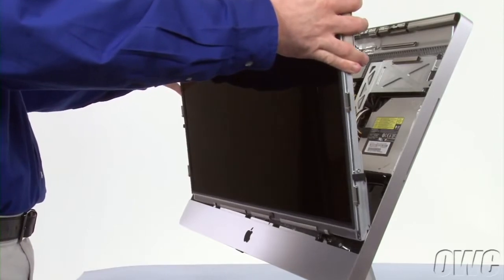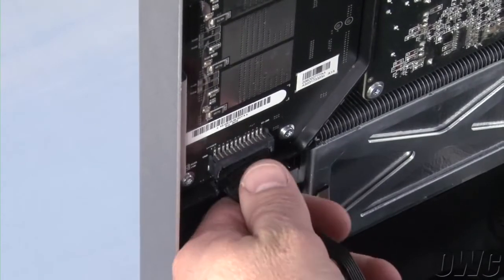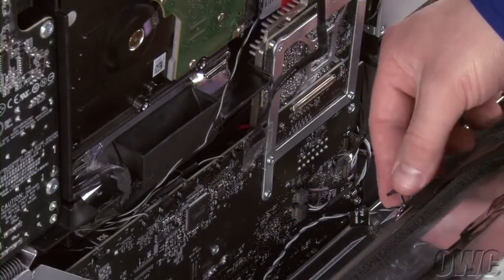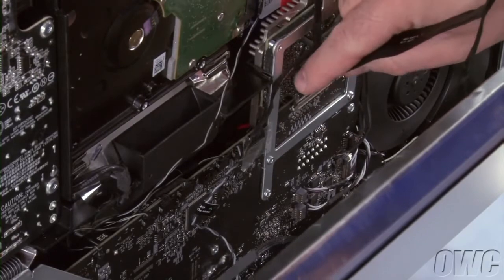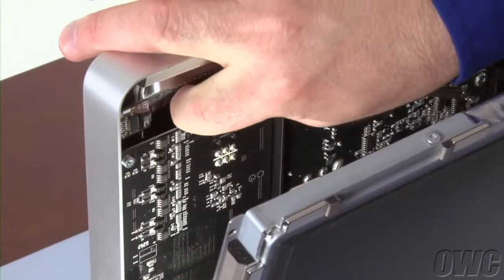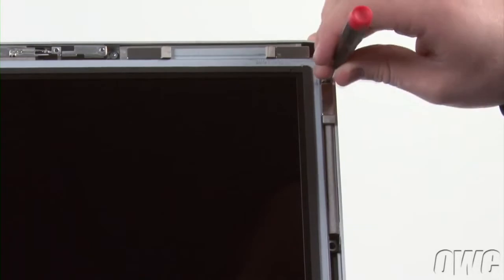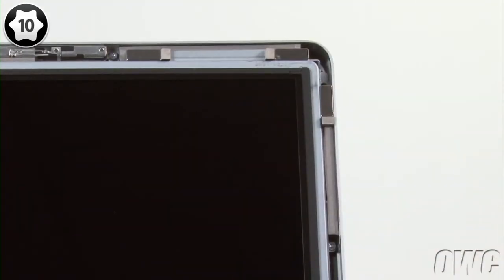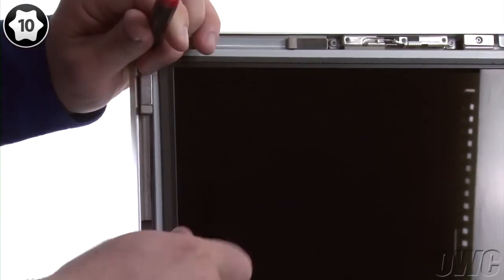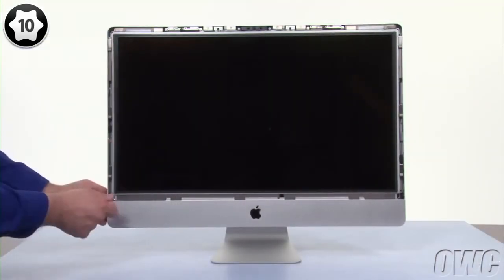Remove the display unit from the bag and, once again being careful not to touch the screen itself, set it into the iMac. Reattach the backlight power cable in the lower left by sliding it up into its socket until it snaps into place. Then reattach the display temperature sensor cable by aligning it with its socket and gently pushing it into place. Next, being extremely careful, line up the DisplayPort connector with its socket and push it into place until it clicks. Finally, reattach the vertical sync cable and lean the display back into the case. Use the smallest flathead screwdriver in the kit and slide it through the top screw hole in the display and into the hole in the iMac to align the screw holes, then insert one of the Torx T10 screws so that the screen doesn't fall. Repeat the process on the other side, then replace and tighten all remaining screws. Use your tweezers if the magnets make installing the screws difficult.